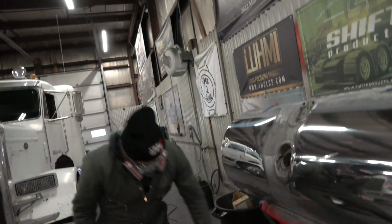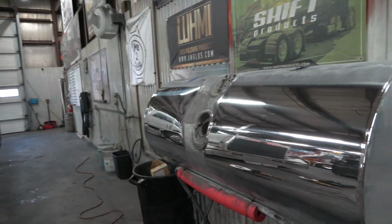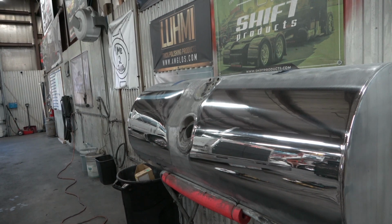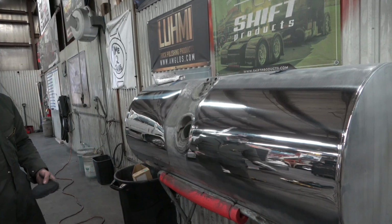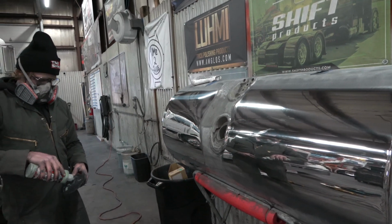So now we're going to lightly clean, and with the light cleaning, we're actually going to wipe part of this off this time, because we don't want it to be really thick, because we don't want it clogging up our white pad. And now anytime we stop to re-rouge on this one, we're going to rake our white buff, because we don't want it to get scratchy.